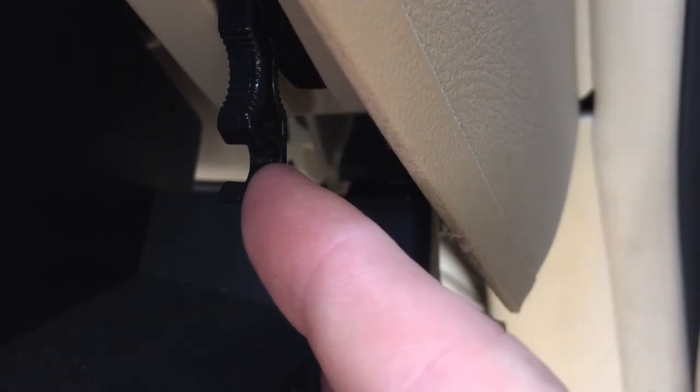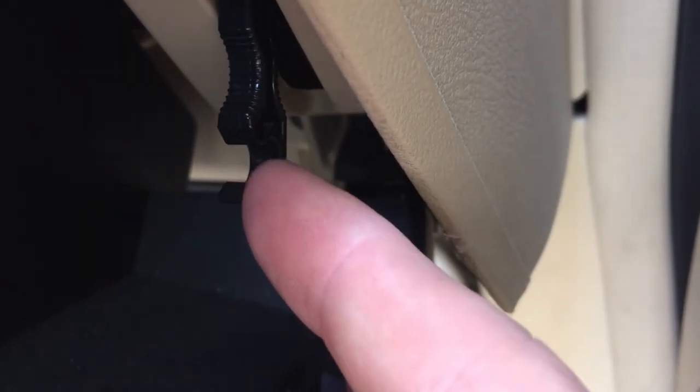Mine was broken before — I replaced it a couple years ago. So you've got to be careful when you detach it: there's like a little hook in there, so you push it away from you, push it towards the front of the car carefully. Really carefully — you don't want to break the hook. Just push this away so it's out of the way.